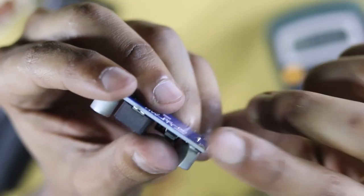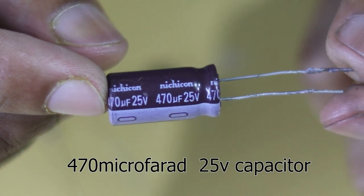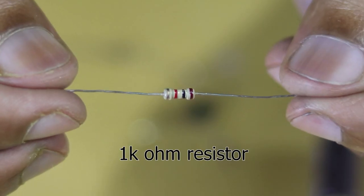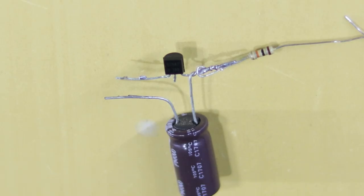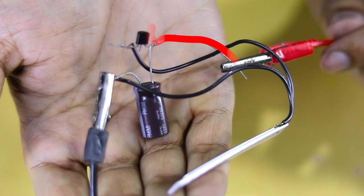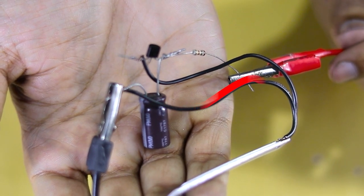Now I'm going to make the back red LED light which will be blinking, then the white light for the front, and the green light under the water bottle. Before that I need to make two circuits: a voltage drop circuit and an LED blink circuit. Each LED light without the wheel light has a maximum power limit between 1V to 6V, but my laptop battery has 11V output. For the voltage drop I chose a voltage step-down buck converter. For the blinking LED you need a 470 microfarad 25V capacitor, a BC547 transistor, and a 1k or 10k ohm resistor. I connect the capacitor positive line to the transistor right pin, connect the resistor on the positive line, and its output goes to the transistor left pin, then to the light's positive line. The negative line connects to the capacitor's negative and also the light's negative. The LED is blinking.